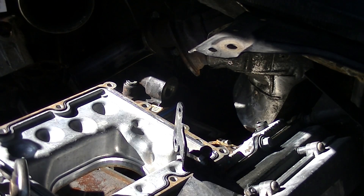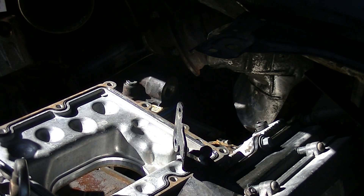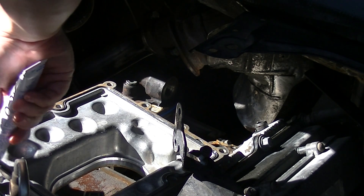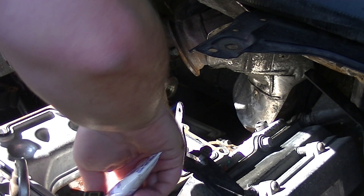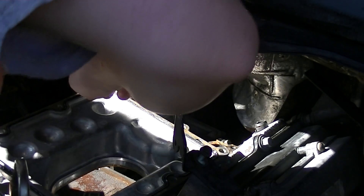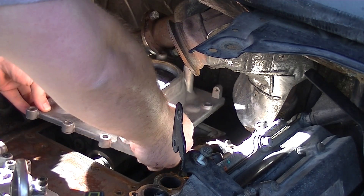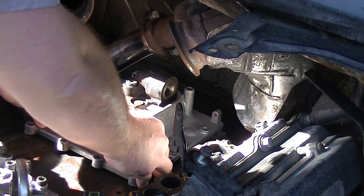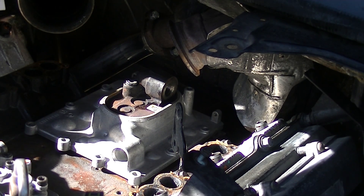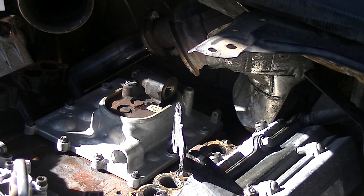Make sure it's clean back there. This is the high-pressure cover, so I'm just going to do a little bit right along here at the corners — just a very small bead. This is just to help the seal; I'm not looking to do anything major with it. Take this cover, get it back there in place, all ready to get all our bolts back in. These only go down to about six foot-pounds.